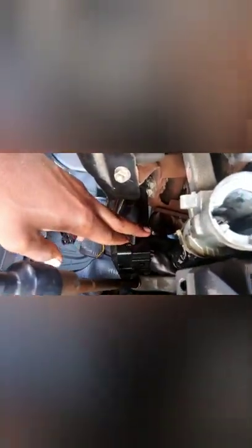Step one is done. Now the switch is back here — you see the white connector it connects to. If you put your hand all the way behind it to where you feel the wires going in and go all the way to the top, you'll feel a little Phillips screw — that's what's holding it down. To get to that, if you had a stubby screwdriver you might be able to get it easier. We don't have every mechanic's tool, so with an average-sized screwdriver we're most likely going to have to take off that little air duct to stick the screwdriver back there.